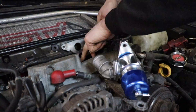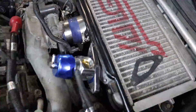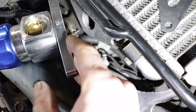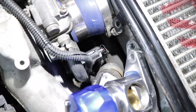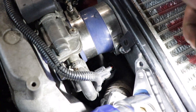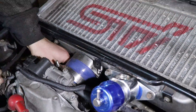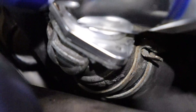The way I got that bottom hose back on — which goes back into the intake — I was holding the clamp with pliers while stuffing this in there. One thing you've got to watch out for: make sure the clamp is actually all the way around the hose. It was getting caught on the lip of the pipe, so it wasn't clamping correctly. Double check that it's on there correctly. Also make sure the clamp is still latched — with this one it has to be unclipped because otherwise it's not actually grabbing the hose.